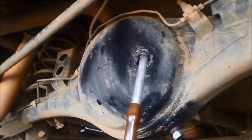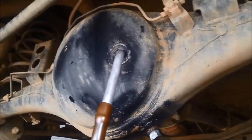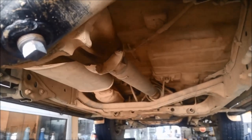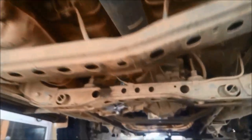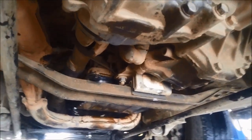Just make sure you put the proper oils in. On this particular one it's got the limited slip 140 in the rear diff, limited slip LS 80/90 in the front, and you can put multi-trans in the transfer case or the center diff. Put the weaker magnets on the fillers. Double and triple check your work — make sure you haven't forgotten to tighten anything up. Just got to put some transmission fluid in this one, and you test these with the motor running at operating temperature.